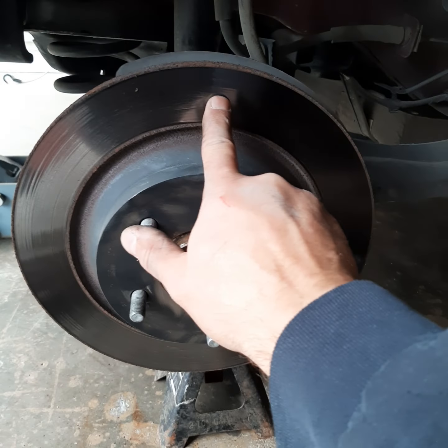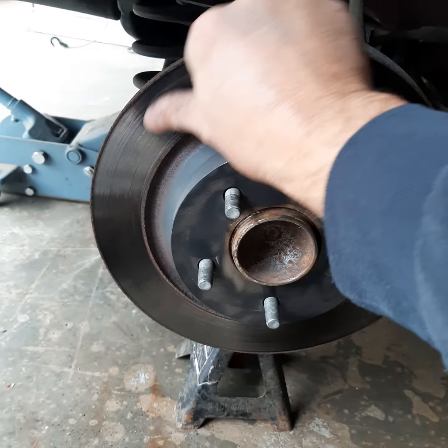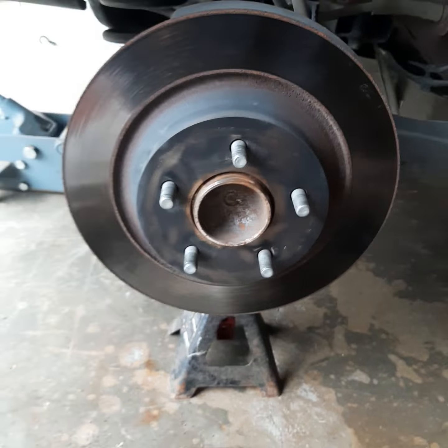So this is the lube and chamfer approach. You lube everything that needs to be lubed — that helps cut down on vibration and harmonics, which can help quiet brake noise. Chamfering the pad means taking a flat edge and putting a bevel on it, giving it a tapered edge that helps cut down on chatter. Some brakes come factory with a chamfer, not all of them do. We're also going to do a light sanding with 80 grit — scuff it up all the way around and do the backside too — to hopefully eliminate this customer's cold morning backing-up noise.